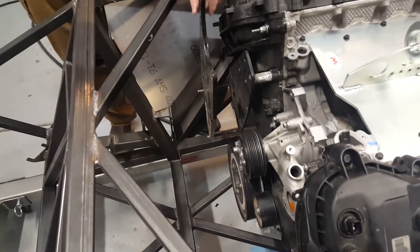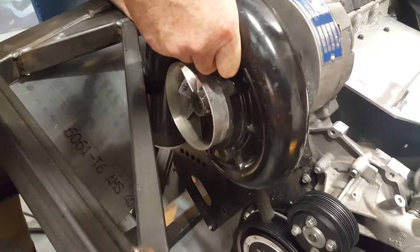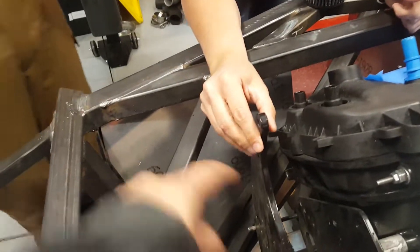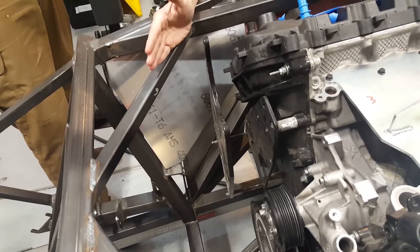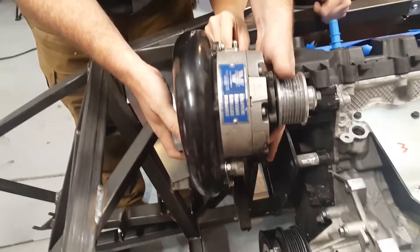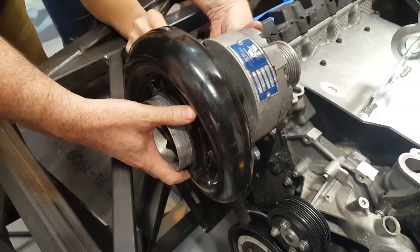That's not quite right. I think we just learned that it's not going to fit. It's not that far off. Just saws-all into here — why is this so far out? The pulley is going out. I got it — the blower mounts external, so what we didn't account for was the extra width. This bar needs to go; it wasn't here — six or eight inches. Well, just saws-all through that bar. We need about half of where that bar is — you could probably notch it, but when the engine moves around, why not just get rid of it?